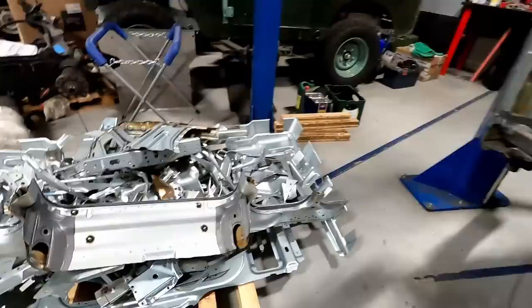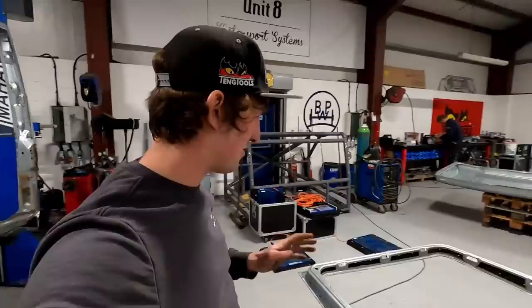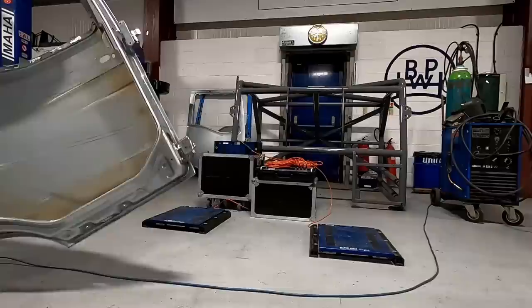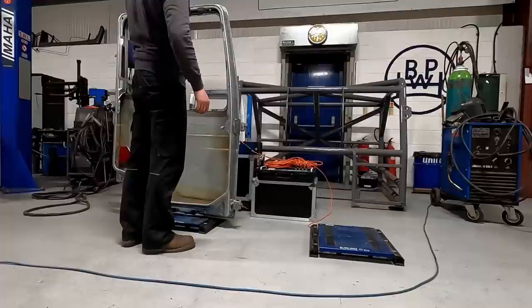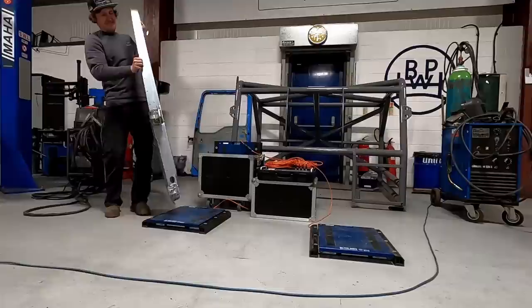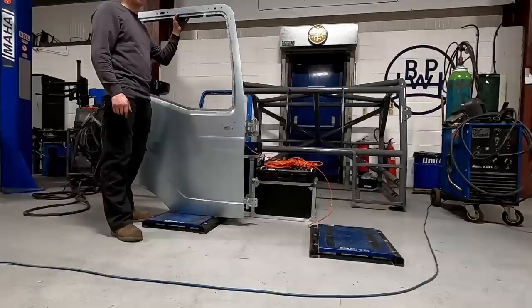It's been a few days and while it looks similar we've taken quite a lot of metal out of it. We're now going to weigh the doors to see how much weight we saved. Tom's saying 20 kilos per door, I'm saying 18. The modified door came in at 16 kilos, and the standard door at 28 kilos — so it's 12 kilos lighter, which is quite disappointing.